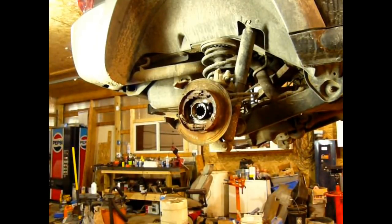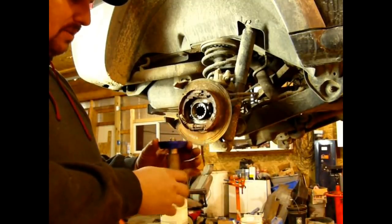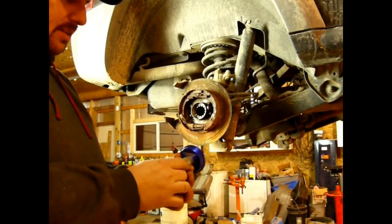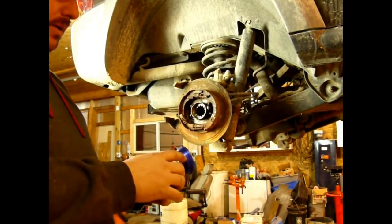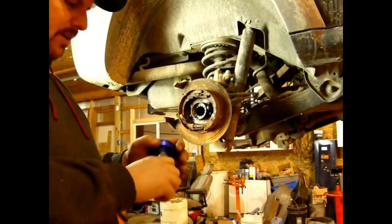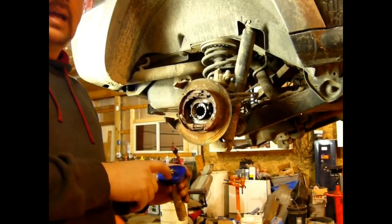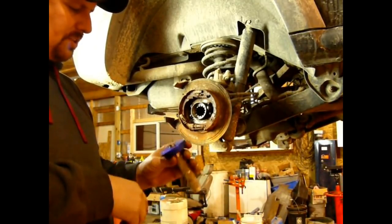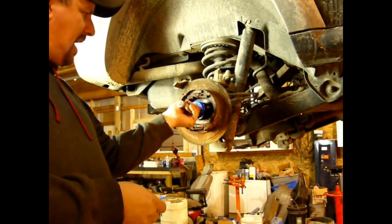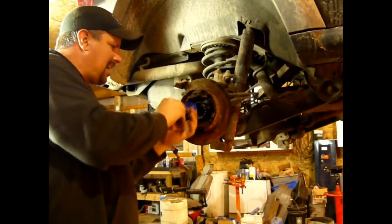And you can use anything to drive the seal on. I spent, I think, like $35 on a Harbor Freight kit, and it comes with this driver, and then you just unscrew this little nut from it, and it's got a whole bunch of these adapters. This is for installing wheel bearings, like the old serviceable style bearings that go in the front rotors on vehicles. It installs the bearing races, and then it also installs the seals. And it's got 9 different adapters, all different sizes. But if you don't have this, you can use anything. You could use a hammer, a piece of flat stock, a larger socket, anything at all, just to drive that on and then just make sure that when it gets to the axle tube, it's flat.